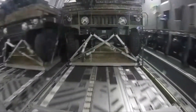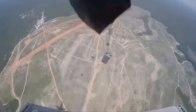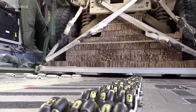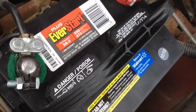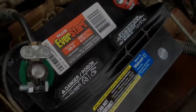Apart from that, the Humvee is not a 12-volt system like your civilian trucks — it's a 24-volt system made up of two 12-volt cells run in series. These 12-volt cells can be slightly more expensive Duracell batteries, or you can just buy two Walmart specials and run them in series and there you have it: 24 volts. So why would you need a $400 or $600 charger to charge that?